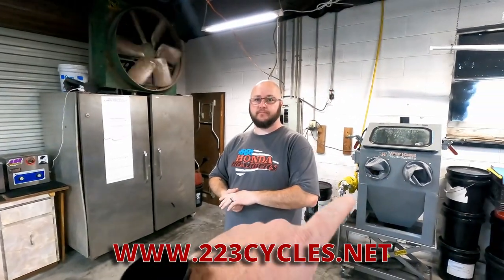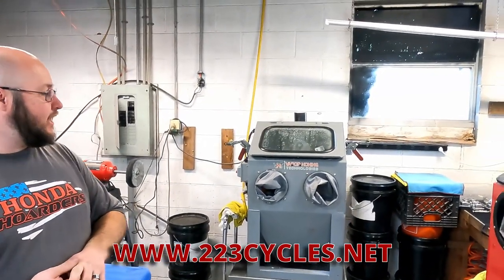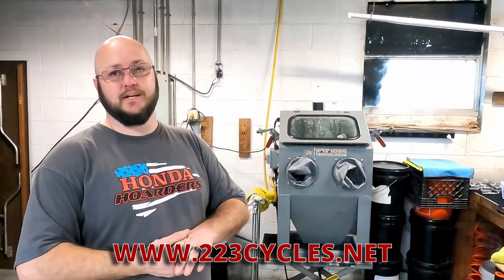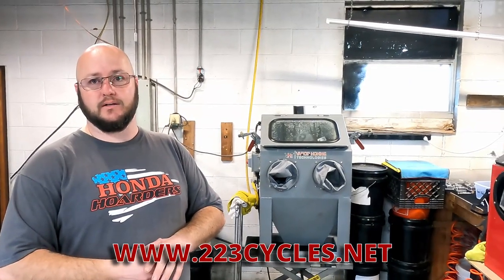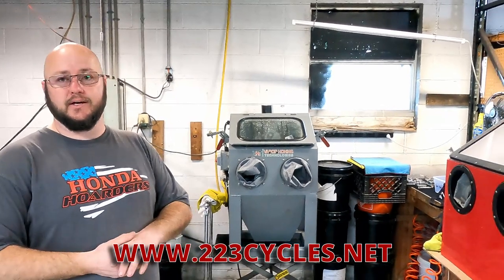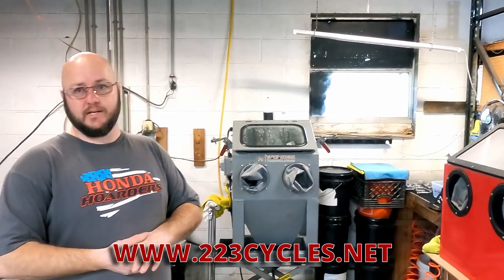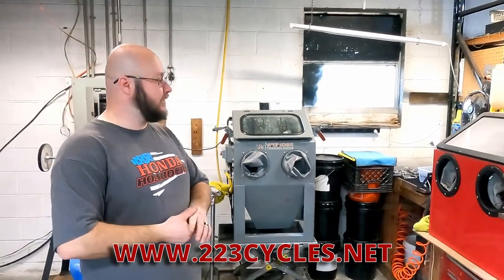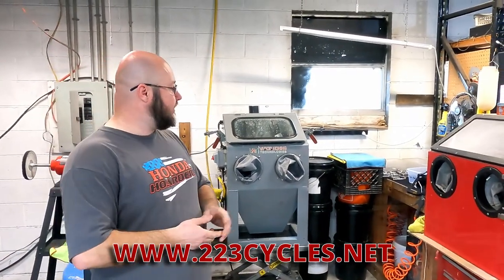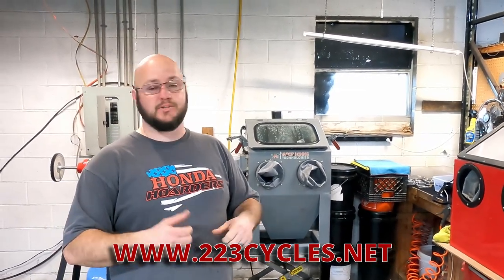Now the vapor hone, is that a glass bead and water? Yeah. Okay. So what they call is a slurry mix. Slurry, that's right. It'll have a number 13 ultra fine glass bead, so it's almost like a powder. Okay. And then distilled water. So typically about 20% glass bead to water. Okay. And from there, all the little parts get either hand polished, machine polished, or powder coated.